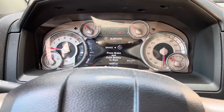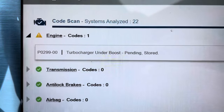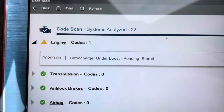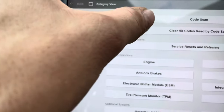When you're done cleaning it, jump back into the truck. You can either disconnect the battery and reconnect it to clear the codes, or you can use a scan tool. This is the scan tool from work — that is the code that comes up. The most common thing I've found with this code is that boost pressure sensor. Clean it, go back and clear the codes or disconnect your battery — either one works.